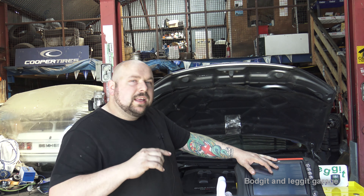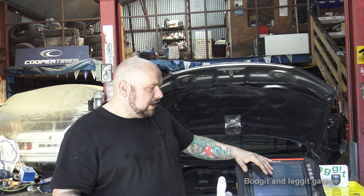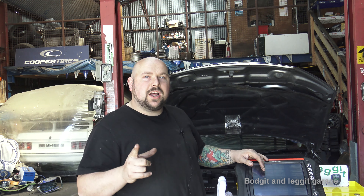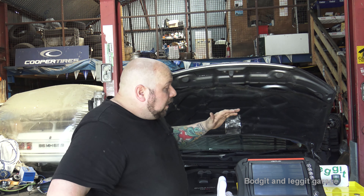Fords — because this is a Ford — have a key-on-engine-off and key-on-engine-on test. Be aware there are different tests for different cars. The more expensive the scan tool, the more bi-directional controls you have. But the information isn't always correct — I was doing a VVT sensor on a BMW and the information in the tool was completely wrong. We still fixed the problem, and the main dealer didn't, so that's more brownie points for me.